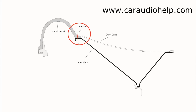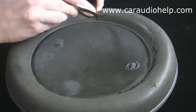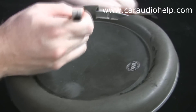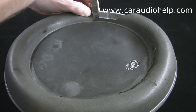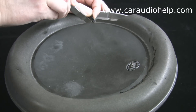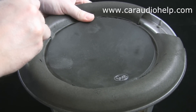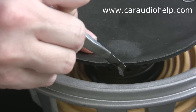This will not be seen once we install the new surround. I am using a small razor knife with a new blade to ensure it is sharp. I start by making a single cut from the outer edge of the surround to the inner edge of the cone, which allows me to pull the old surround away as I make the inner cut. The inner cut is made by keeping the edge of the knife parallel to the inner edge of the cone, using short saw-like strokes to cut through the original surround and the thin bottom layer of the cone. Use the top surface of the outer cone as a guide but be careful not to cut into the top cone layer — you only want to cut through the foam and into the thin outer ring of the bottom cone layer. Keep the original foam that will sandwich between the layers intact. Now we should have the bulk of the foam removed. You can make a second pass to clean up any stray bits, but don't fuss with it too much, as this edge will soon be covered by the new foam surround.